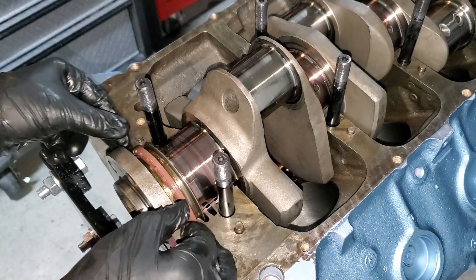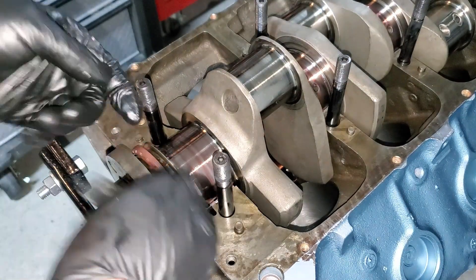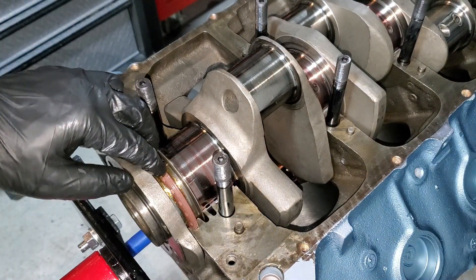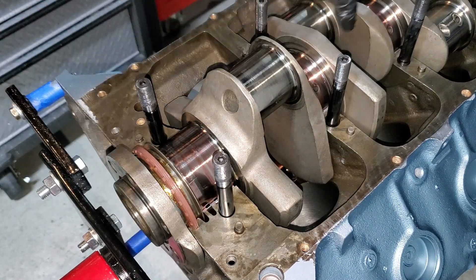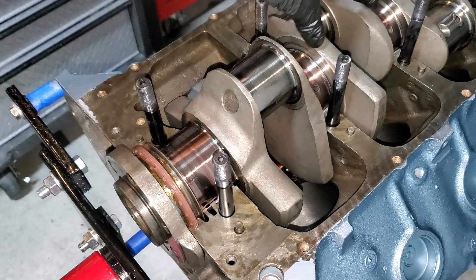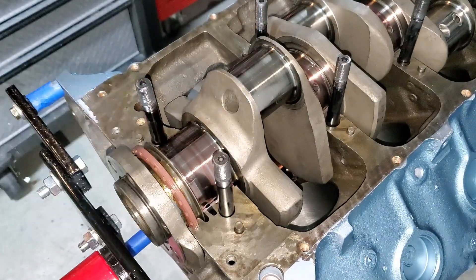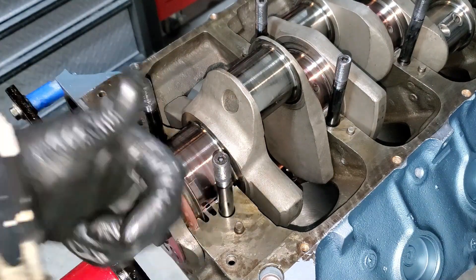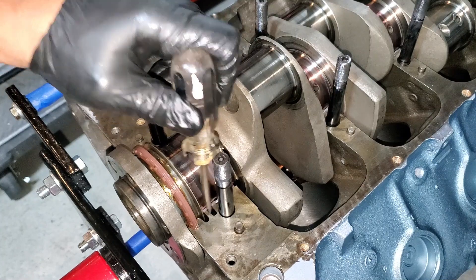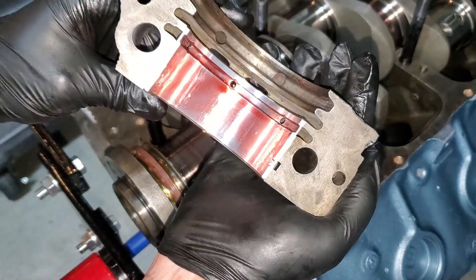I had the back of the crank slightly elevated and pushed the seal down so it connects at the bottom. You can push down on the seal and feel it engage a little further down at the bottom — that'll help. It's okay if it moves a little bit; when we put our cap on it'll lock it down and push it into place. Check your bearings now because I rotated the crank. If one of your bearings slipped, take a flathead screwdriver and on the side that popped up, push it down gently until the screwdriver and the bearing are flush with the block.